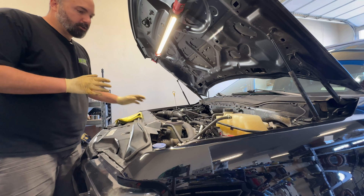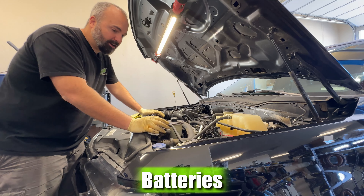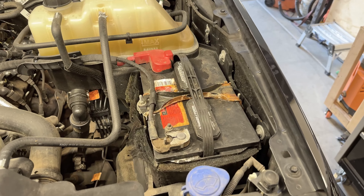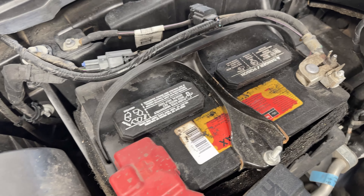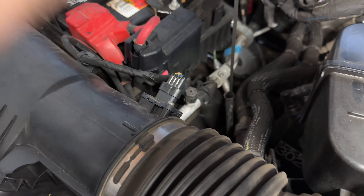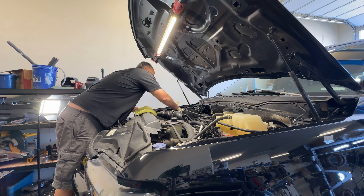Up under the hood, we're going to start with some general inspections. Something that everybody with one of these trucks should be looking at is your batteries. These come with a lead acid battery for the most part. I've heard of some guys having AGM batteries installed new. My old truck had these same lead acid batteries — they're terrible. I'm working on convincing my mom and dad to upgrade to AGMs and then we'll fix that in Forscan. You can see they corrode and make a big mess in here. We're going to double check our oil level — I always recommend checking your oil level before your oil change, just to see if we were consuming any oil, or once we get underneath, if we see any oil leaks.